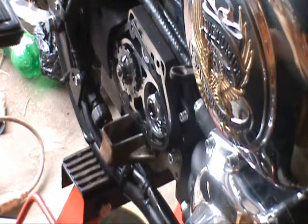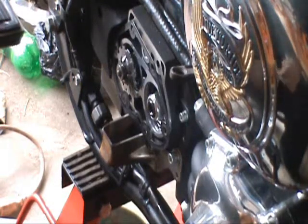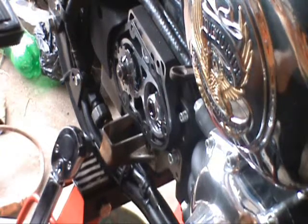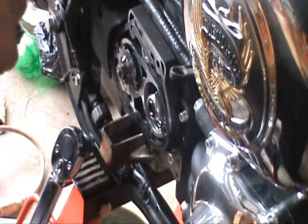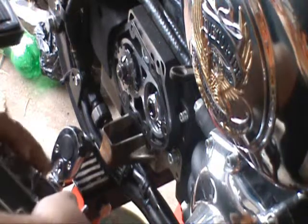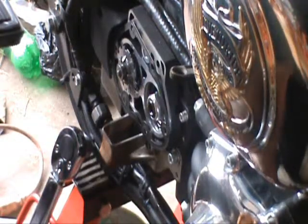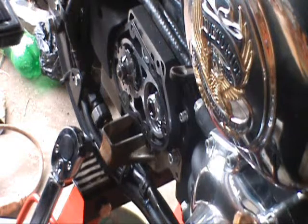I have this here. Just kind of want to see how to get these — I think these should have access with that. Kind of want to get everything lined up here. Let's put some Loctite on these bolts. Get them in there, get them snugged down, and then torqued to spec before the Loctite dries. So it was 1, 2, 3, 4, 5, 6 — that was the tighten sequence that the book states. All right, here we go.